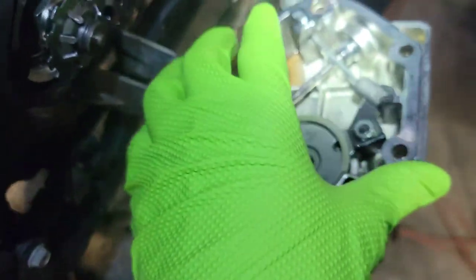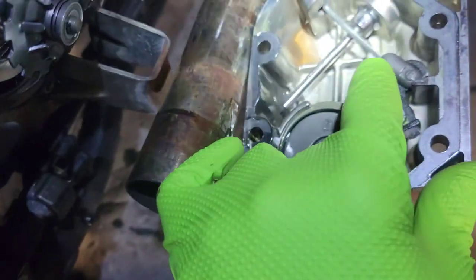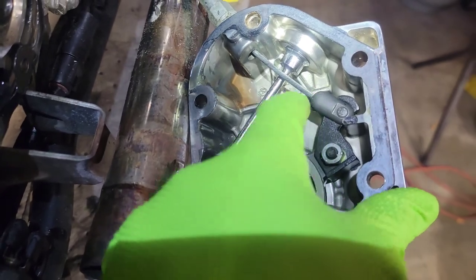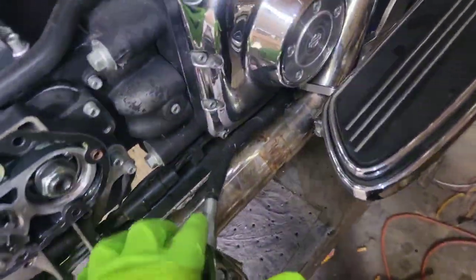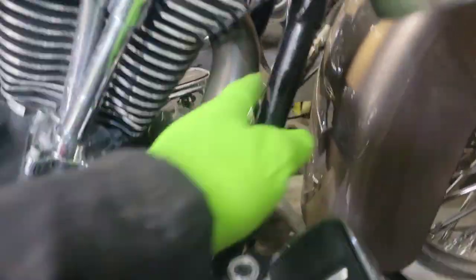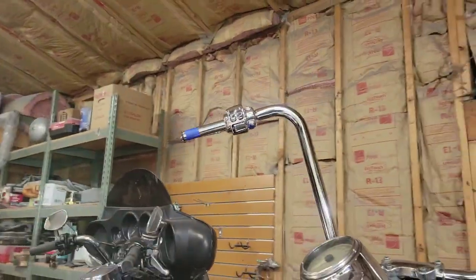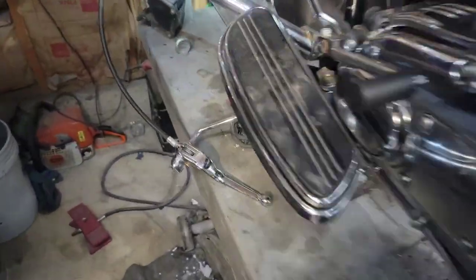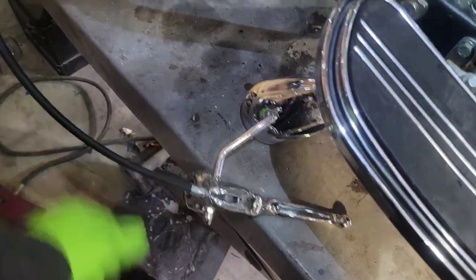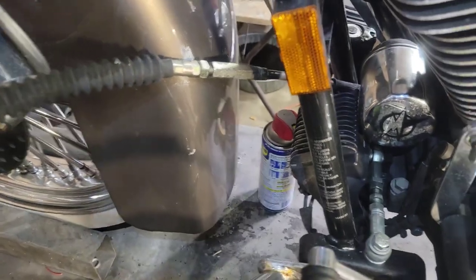This right here is where the cable comes out of the back side — there's a little ball on the back that slides through the hole on the cover. Now we're gonna rerun this whole cable that goes up to the clutch, over the other side, back up to the bar. Here's our existing clutch cable — we're gonna replace all that and put it all back together.